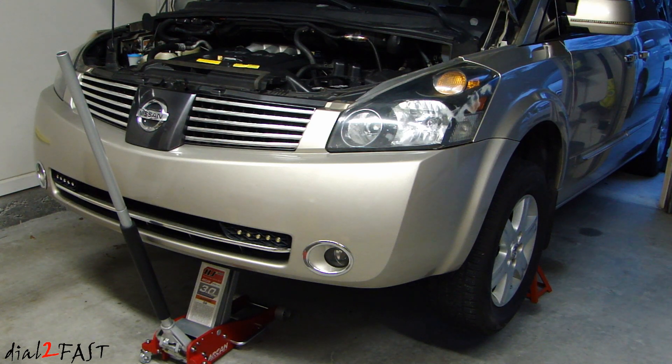The takeaway from doing this job: when you are bleeding the air out of the system, make sure you have the front end elevated as high as you can — that will help get all the air out. Also, if you have the no-spill funnel that will help even more because even mechanics at dealerships use that. Lastly, let it run for a good 40 minutes and squeeze the upper radiator hose periodically to get the air out. If the engine isn't overheating but there's no cabin heat after 40 minutes, rev the engine to about 1,500 RPM for a couple of minutes — for my vehicle after about four minutes I could start feeling heat coming out from the vents.